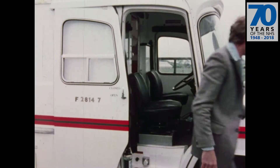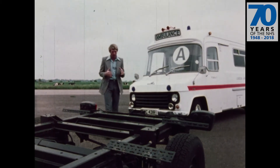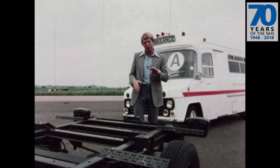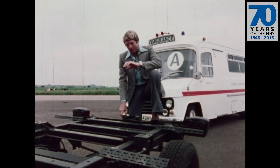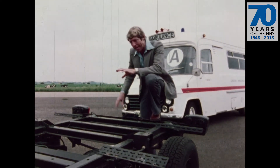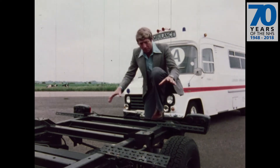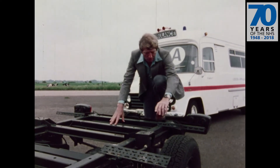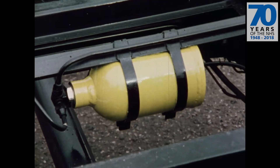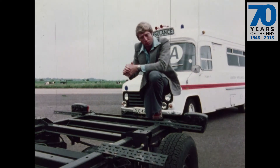We can see it rather more clearly on this stripped-down chassis. It's called active because, unlike conventional suspension which absorbs bumps in the road and changes in load during cornering, this system senses those changes as they're occurring and positively responds to maintain the body's position. The wheels aren't mounted on conventional leaf springs — they're mounted on a combination of hydraulic strut and a gas spring. At the back there's one gas spring to serve both wheels; at the front there's one for each of the two front wheels.